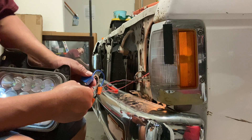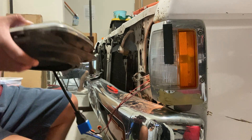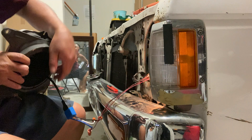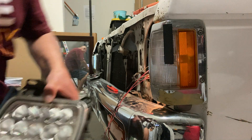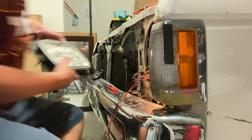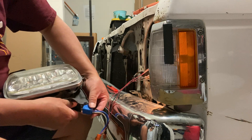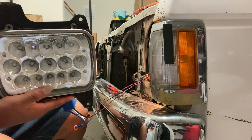Okay, so it's getting enough to run this here, but not all. The driver's side has all of these working — all of these are lit up on the driver's side. Let me unplug it. The driver's side has all bulbs working on the high beam. On low, the driver's side went out because the white wire isn't connected, so that'll be next. I plug this in here and we still have nothing, but yet we still have the 12 volts.